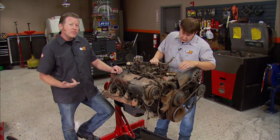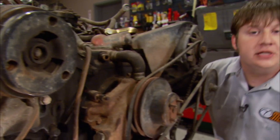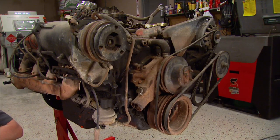That brings us to a little bit of interesting history on the 396. Starting in 1970, all GM 396 big blocks were punched out to the 402. They kept the 396 badging on the smaller cars like the Camaro, Chevelles, and Novas because these engines had already earned a big reputation in the racing world. Then to add to the confusion, they marketed the same engine in larger cars and trucks as a 400. Nobody really knows for sure why GM did this, but rest assured — regardless of what the badging or the brochure says, if it's a '70 to '72, then it's actually a 402.